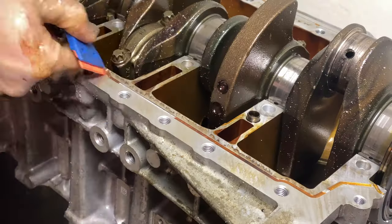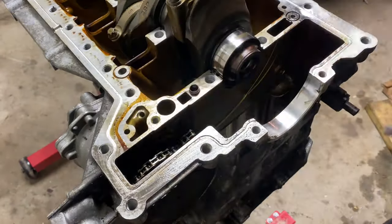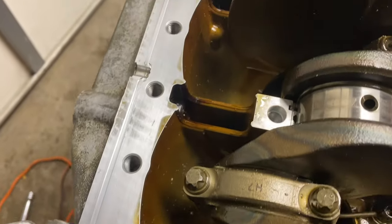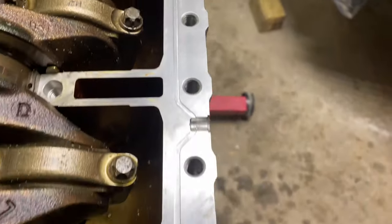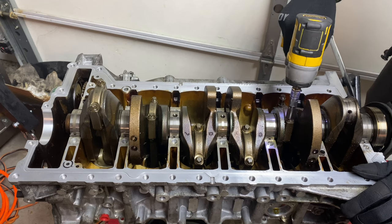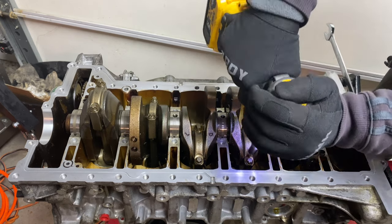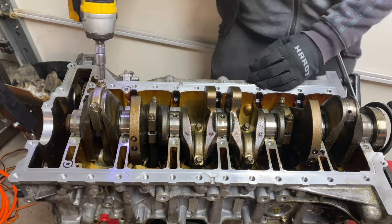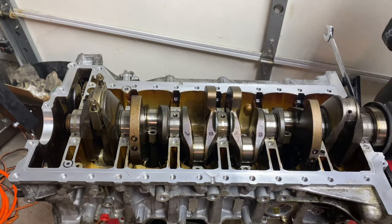Having actually accomplished something, I decided it was time for a little more cleaning. A big part of engine rebuilding is getting rid of all the old muck, gaskets, and buildup. If I were to do this again, I would definitely get a parts cleaner or maybe a Dremel with a soft pad to make things easier. At least getting it to look new again makes you feel like progress is being made. Now that I felt better about how it looked, I removed the connecting rod bolts and the connecting rod bearing caps on the back end. It's very important that the connecting rod caps do not get mixed up and go back to the correct connecting rod when reused, or you'll have another knocking engine very soon. I marked them and put them aside until they're needed again when we replace the rod bearings in the next video.